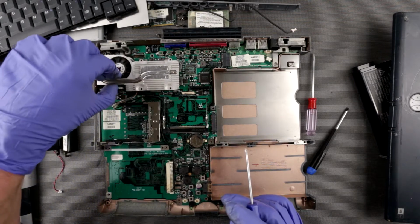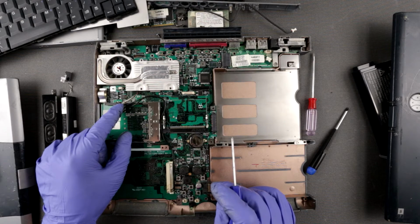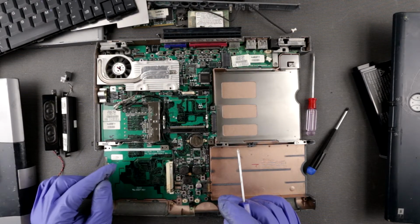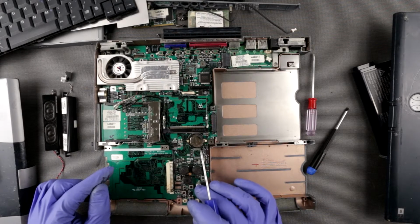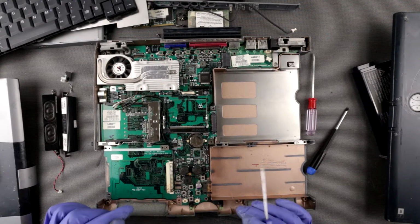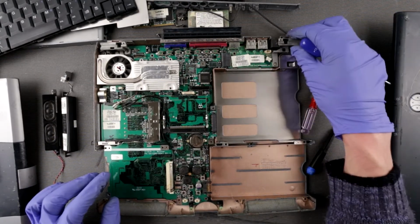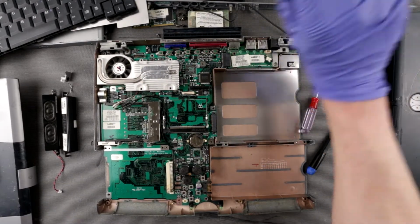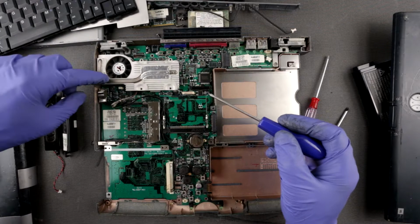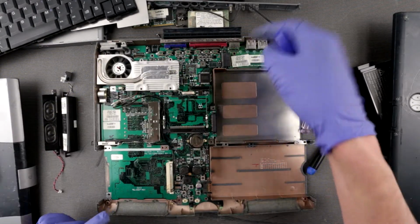There's not many capacitors around here except those. Are those capacitors or diodes? Capacitors. So here, some tantalums, I think they are. But this is only one electrolytic like that, and it leaked. Sorry, should not swear. Okay, so what else can we pull out of here? This is the most interesting for me at the moment, so I'm not gonna go there yet.